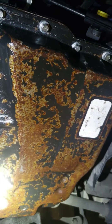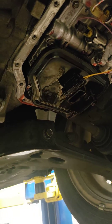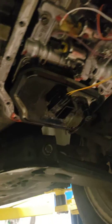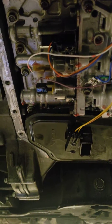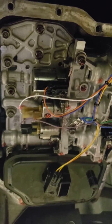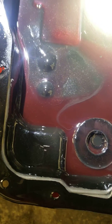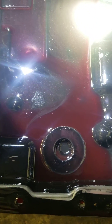We'll take the pan off and take a look at the valve body. With the pan off, the leakage was likely because the bolts were not fully tightened, which leaves me with concerns about whether the valve body was torqued down properly. In the pan itself, there is some sparkly material — some metal debris.